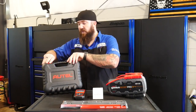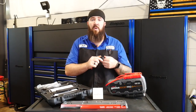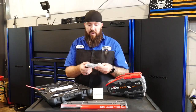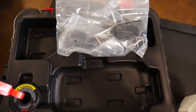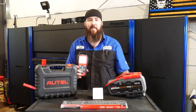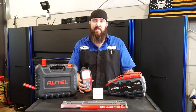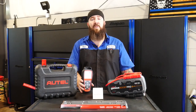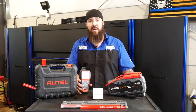In the kit there are quite a few other small items for older vehicles that require activation with the magnet tool. It does come with the magnet, the instruction manual, the charger cord, and the USB updating cord. One of the big fallbacks is that it cannot plug into the OBD2 port of a vehicle — so if that specific vehicle line requires you to plug the service tool in to do a physical programming of new sensors, this is not going to be able to do that. It will tell you whether it has its own relearn process or if you'll need another tool to plug in and relearn those sensors.